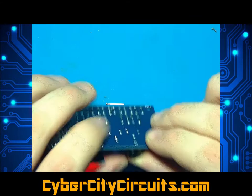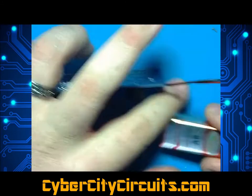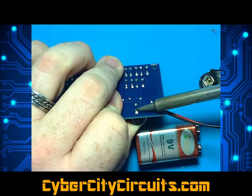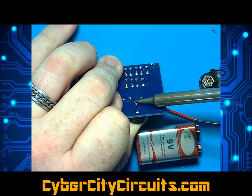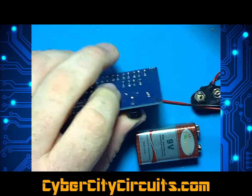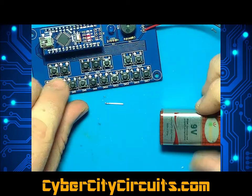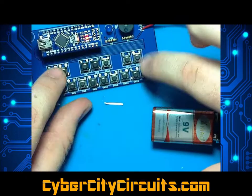It's noisy. Remember how before I told you if it's a little noisy? Let's power this off. If it's a little noisy, you just kind of squeeze the speaker back in. A little bit of room between the board and the speaker, just squeeze it and then heat the pads. And a lot of times that'll fix a lot of that squeaking that the speaker does. Yeah, see? Yeah, it all went away. Look at that.